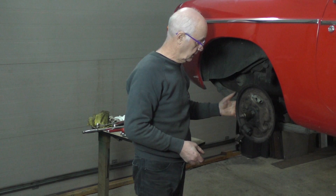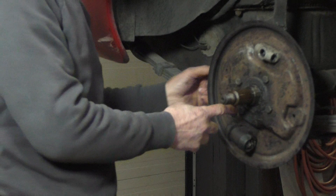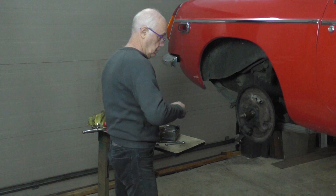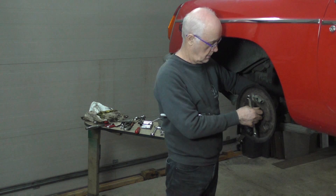There's also a join where sometimes it leaks - there's a join behind the oil seal that can be a little leak. So that's something I can address if I take it off. I take the four bolts off. If you want you can try with a screwdriver to gouge it out, but personally I think it's better to take it off. Okay, that's all my bolts out.